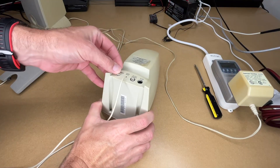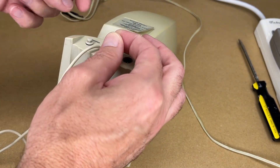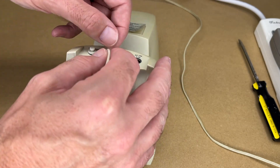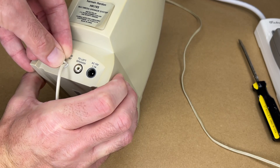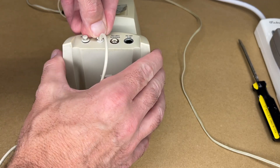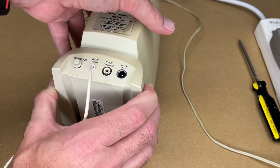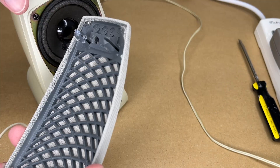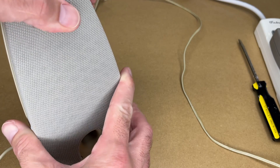I had a little plug in the subwoofer port, and then I'll put these little split bushings in. To get those out you just put some kind of sharp pry tool under them and pull them out. We have the front grill — this had some kind of hot glue in a couple of parts, but you just take a pry tool like a plastic putty knife and pull this off. Then this will just press right back on.